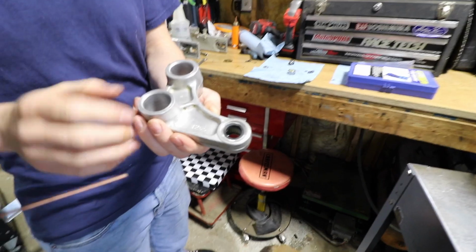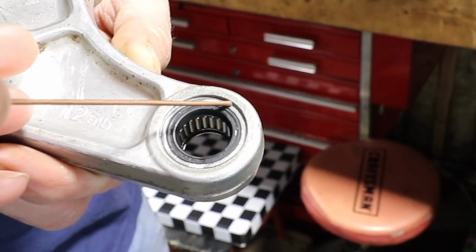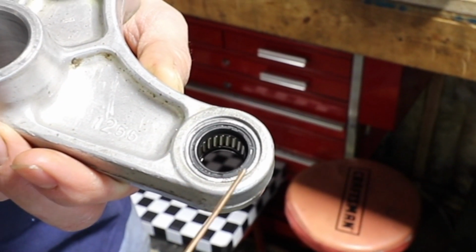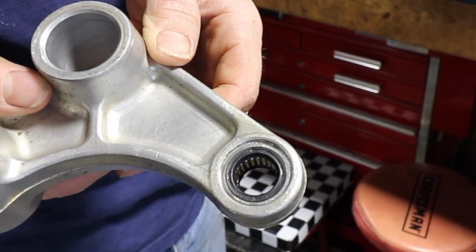All right, so Shtick over here is finally starting to get good. This is a linkage bearing to my dad's old bike. And you can see the outside right there. He bored it out and made a little sleeve that the needle bearing can press into because it was super worn out. Flip it over. The other side, you can tell all right there. It's super worn out, and Shtick pressed a sleeve in there.